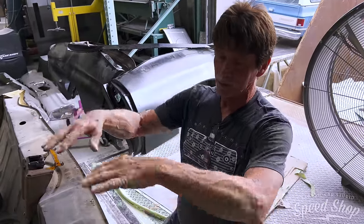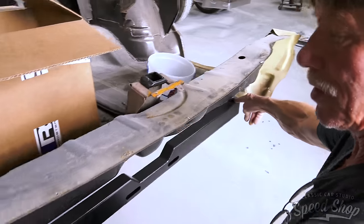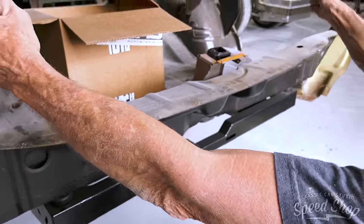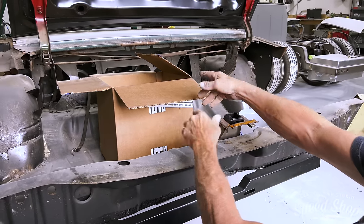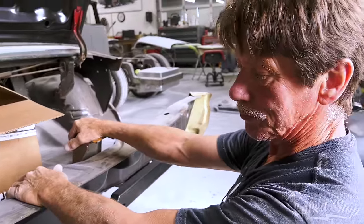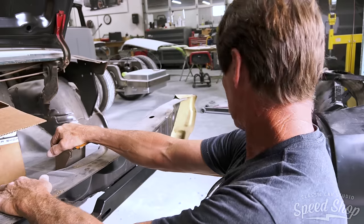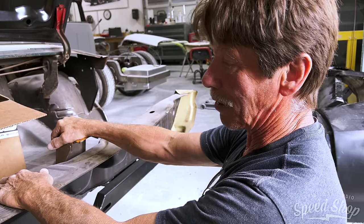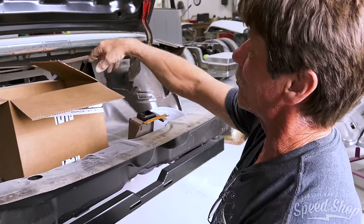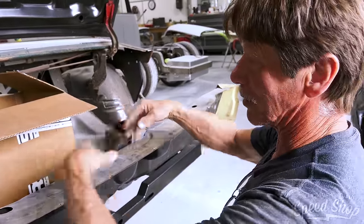No more because they've welded all these floors in wrong. So if you look right here at this section and here on your rear body mounts, this is way far forward than this side. So the whole body needs to shift like this in the frame, but it won't because it's up against the front frame. The torque box areas are off and they won't move because everything's welded in wrong. So how do we fix that? That's the way, you got to cut it all apart and start over. You got this whole new floor pan for the trunk. It's all new. New floor pan for the passenger compartment. And then you just got to start building around it.